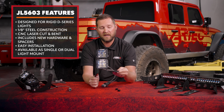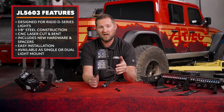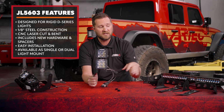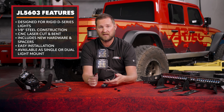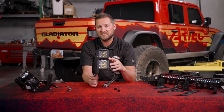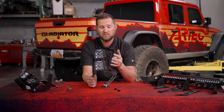But these are going to be made of a 1/8-inch steel. It is laser cut, CNC press broke, uses our 6-stage powder coating process. Just like the hood mounted brackets, these still come with the spacers here to space it off the hood inside the cowl, and come with a black zinc hardware. This way you don't have to worry about rust, corrosion, or any paint getting rubbed off. They fit nice and tight to the body, so you don't have to worry about a branch grabbing the light, ripping it off the vehicle as well.